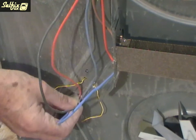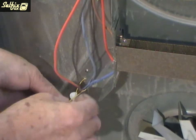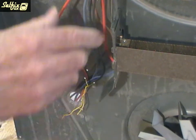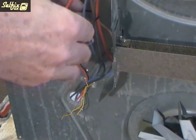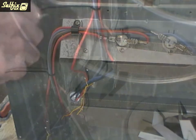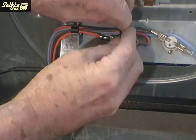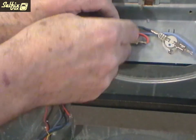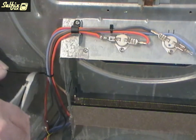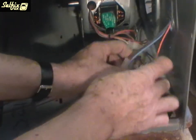Now there is a far easier and quicker method of changing the heater which involves cutting the two connecting wires on the old unit that go into the cabinet and cutting the plug from the new heater. These wires can then be joined together from outside the cabinet, eliminating the need to remove the side panel and any other associated parts such as lid, fascia and kick strip. A large number of engineers use this method to save time, however I will emphasise that you can quite easily cut the wrong wires and find yourself in all sorts of difficulties — so unless you feel really confident, the longer version of this repair will be the safest. I only mention it because there are bound to be people who will say there is a quicker way to do the job, but for your own sake work safely.